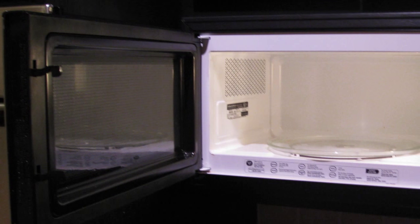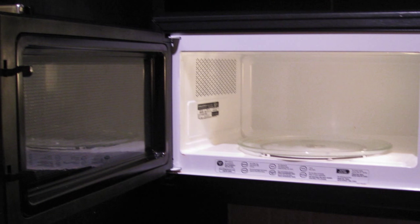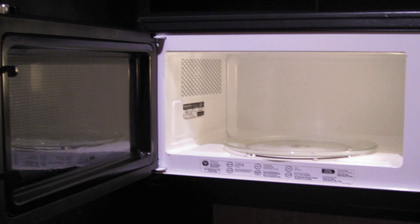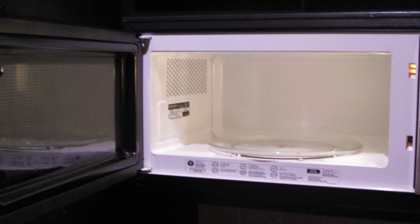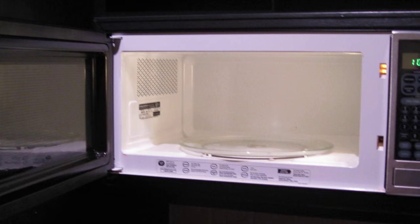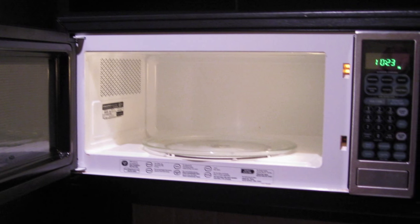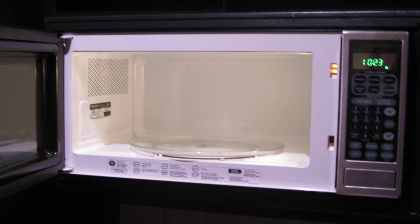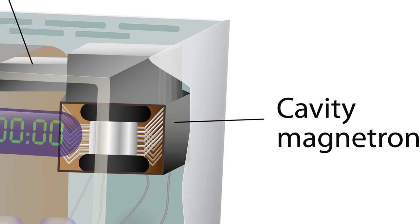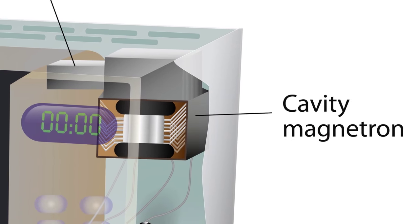So if the inside of your microwave is lined with metal and certain food products such as hot pockets and pot pies have containers that contain metal, why does your microwave manual say not to put metal in the microwave? First, let's talk a little about how a microwave oven actually works. At its core, a microwave oven is a pretty simple device — it's basically just a magnetron hooked up to a high voltage source. This magnetron directs microwaves into a metal box.